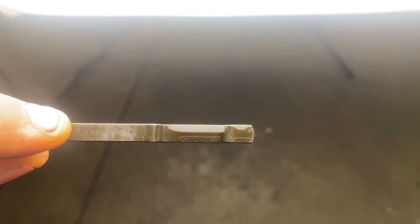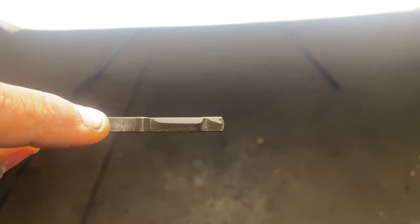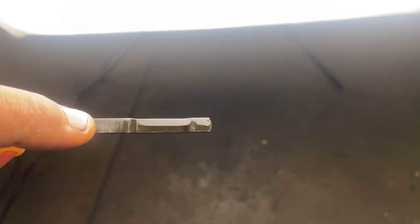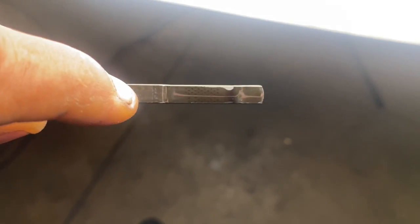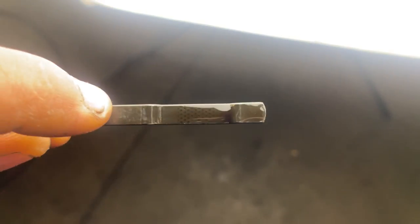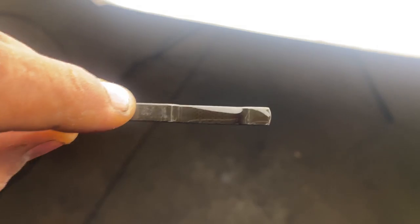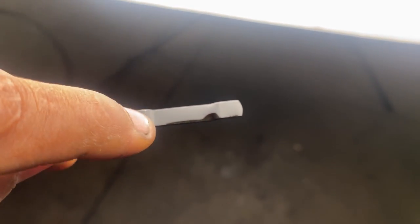This is what it's going to look like after you pull the dipstick out. As you can see, 9 out of 10 times a dipstick is going to have two indicators on it — two lines and two dots, one on the bottom and one on the top. You always want the oil to be in between these two lines. If the oil goes below the bottom line, it's an indicator that you have to add more oil to your car. You do not want the oil where it's not even touching the dipstick at all.